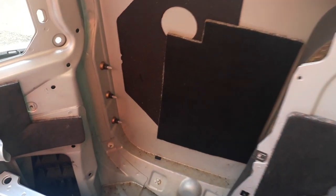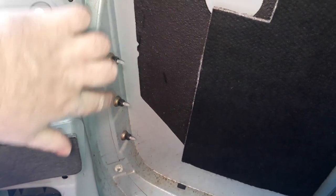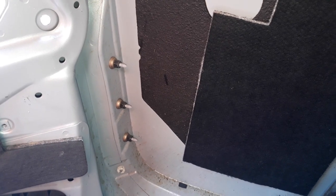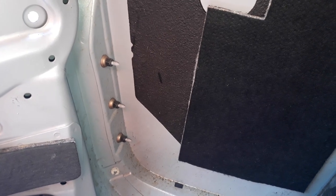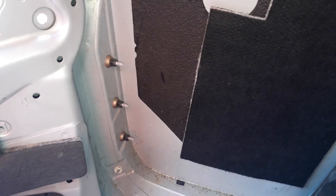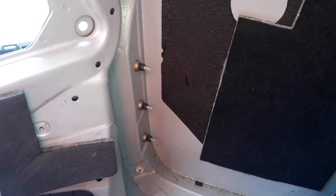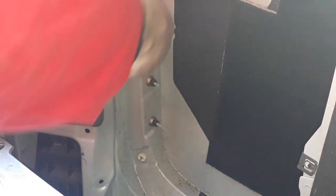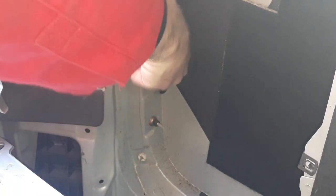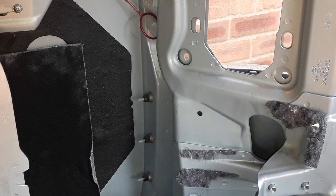On the inside of the bodywork you'll see three studs here. These are the studs that go into the plastic bodywork of the bumper and is bolted to the metal bodywork of the car. You need to undo these three on both sides — these are also M10. In fact, all the nuts and bolts so far have all been M10. Same on the other side.